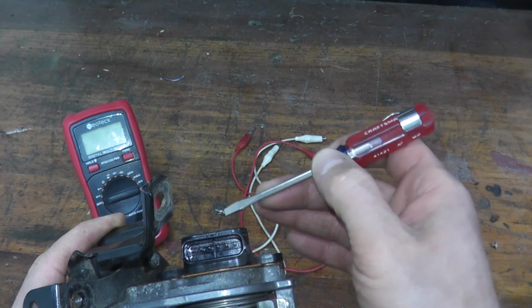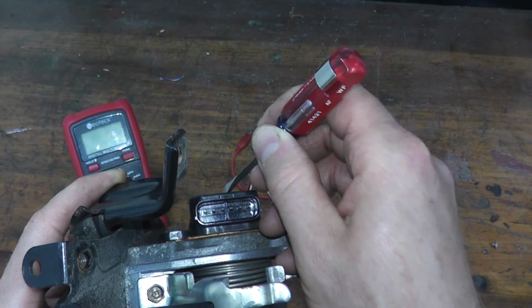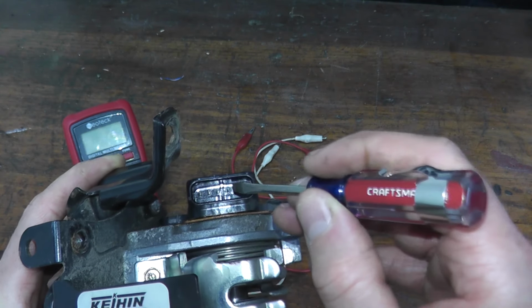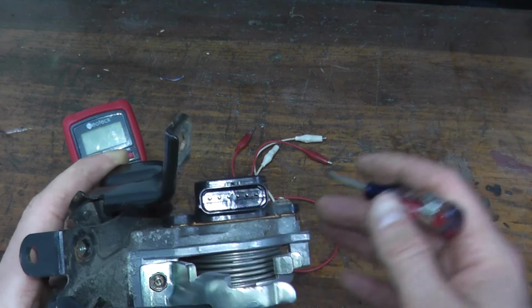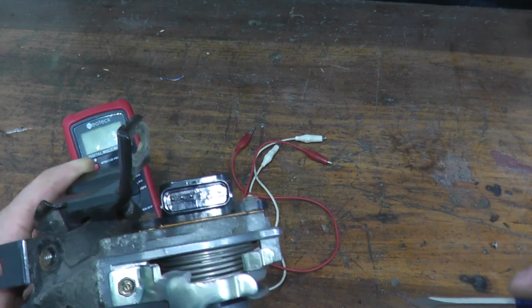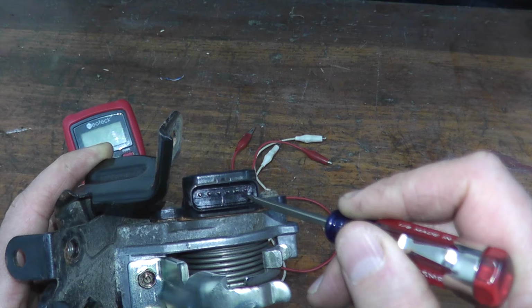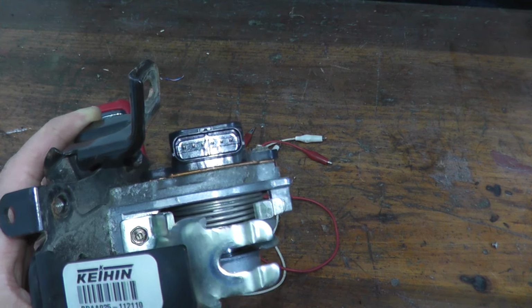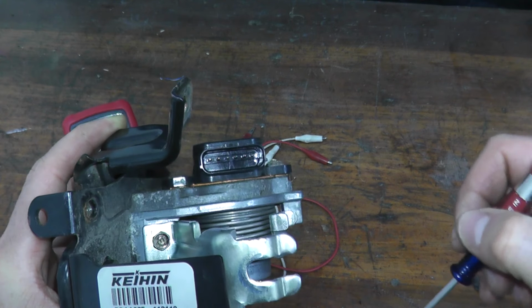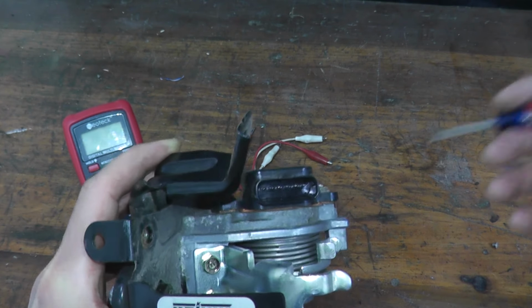one. There's a sensor A and a sensor B built into this entire unit. So if we can imagine, by cutting or slicing this in half, sensor A deals with the right-hand side of the sensor. Sensor B deals with the left-hand side of the sensor. So what I'm going to start off with is testing sensor A, or the right-hand side of the sensor. In my case, that's P2122, P2123. And in the description box I'll correlate the trouble codes with sensor A, sensor B, and so forth.